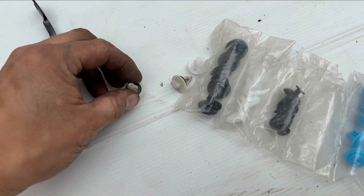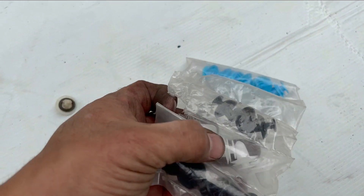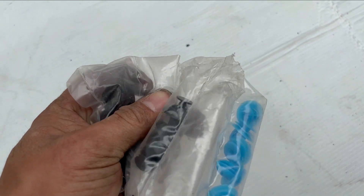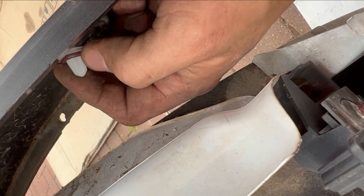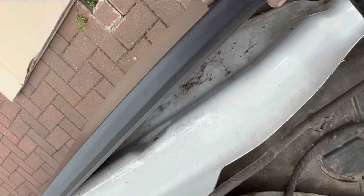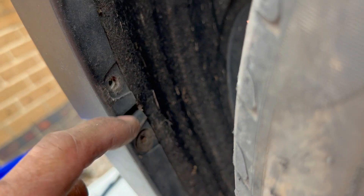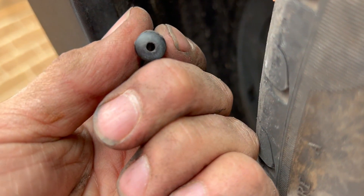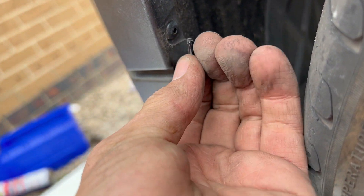I was struggling a bit with that side piece because the heads have come off. I'd always recommend buying one of these generic trim panel kits off eBay because they do fail. Just make sure that's tucked back behind there — you've got your bolt hole for the 8mm screw and these push-in clips. Take the centre out, put them back in one-handed, and get your core in.